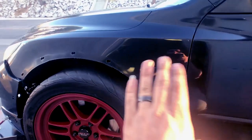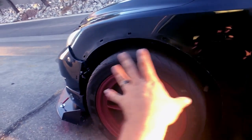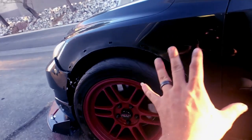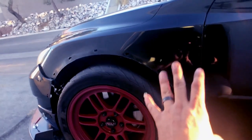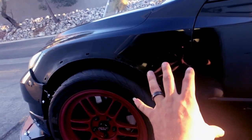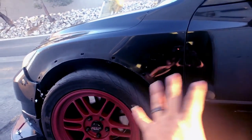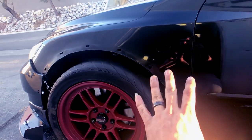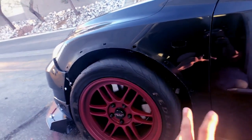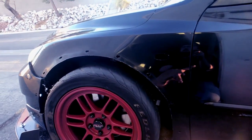I've cleaned it thoroughly. Make sure you guys have a clay bar - you're gonna need to clay bar the surface first. You need to wipe it down completely without any kind of debris or oils on there. Clean it really well until your towel is completely clean every time you wipe it. After that you're gonna clay bar the surface - that's if there's any specks or chunks, the clay bar will pick that up and remove it. You don't want a dust speck messing up your whole wrap job when you're 90% done - trust me, I've learned the hard way. We tried doing the other fender at least three times until we got it right.